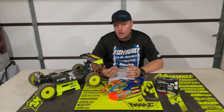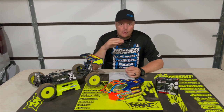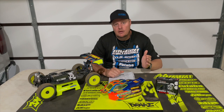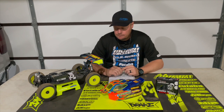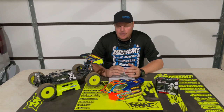I feel like if you don't charge to HV, it's a little bit more stable throughout the entire 10-minute run, where when you charge to HV, the power is slightly more in the beginning. Once it levels off it stays really consistent, but that first minute or so can be a little more power than what you may desire at times. If you're running an electric truggy, it's a 10-minute race, and you're a little bit concerned with runtime, then I would definitely charge to HV.